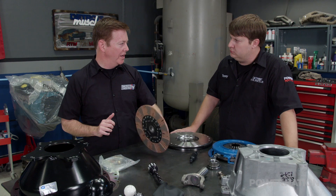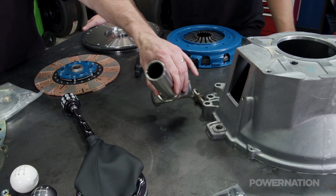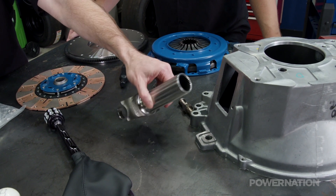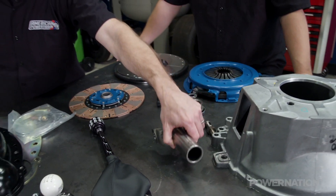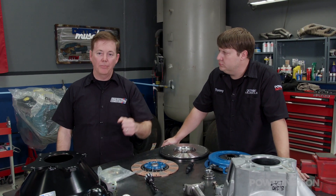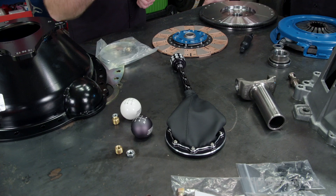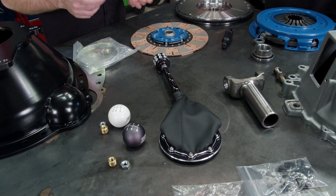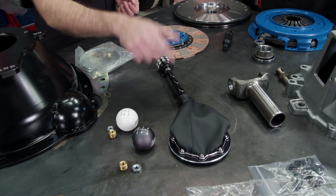And along with the disc, you might as well go ahead and get a pressure plate because you're already in there. You're also going to need the stronger 31-spline yoke to engage the 31-spline output shaft on the TKO. It uses the original U-joints and original drive shaft. And if you don't get quite enough yoke engagement, we have a billet spacer that goes between the rear end and the back of the drive shaft. Moving on to the pretty parts, you'll need a different lever for the inside of the car. This is one of the Finch models — very cool billet, a couple of different styles — or you can go with something more traditional like a chrome lever and one of these white or gunmetal shift knobs.